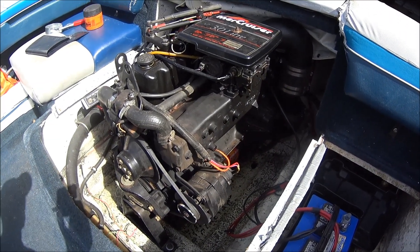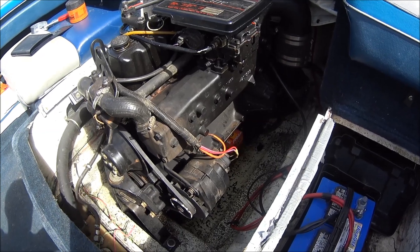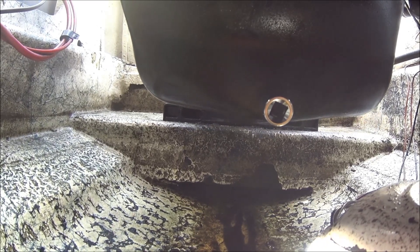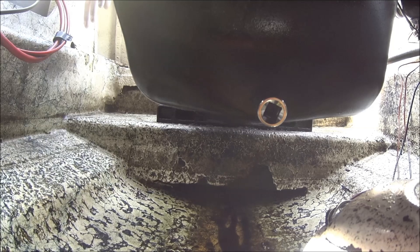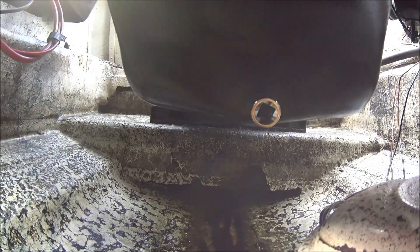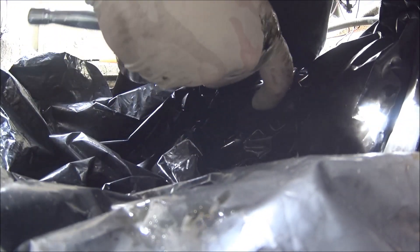Alright, the engine is warm so it's time to drain the oil. I'm going to show you where to find the oil release — it's down on the bottom underneath the engine. Now you're looking right at it. I've placed my socket right on top of the nut that you're going to need to loosen to drain the oil, and I'm going to take that heavy contractor garbage bag. This socket is a 9/16ths.